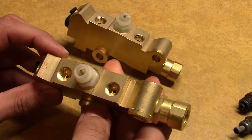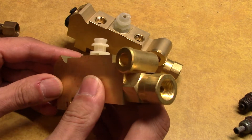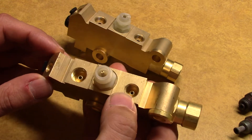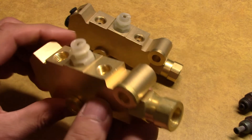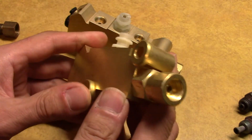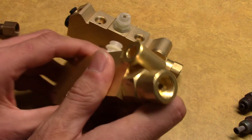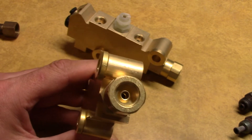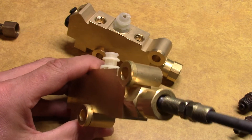Be aware — these were designed for Chevy trucks originally and now people are putting them in everything: rat rods and various other applications. They are listed all over eBay for specific applications that I don't think they're matched up for. More specifically, this PV2 valve — I call it PV2 because that's what it's called all over the internet — has three-sixteenths ports throughout, except for the rear circuit, where the cone in there is for what I think should be a quarter-inch line.